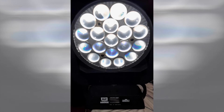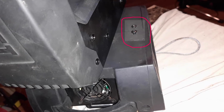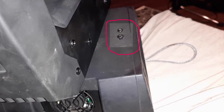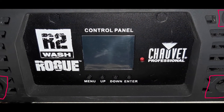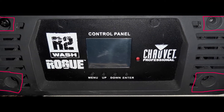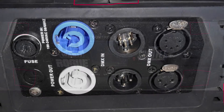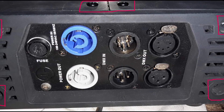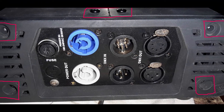You'll have to remove the front and rear panels of the unit and the sides. Remove the two Phillips screws at the top of the unit as indicated here. You'll also have four Phillips screws in the corners of the front panel to remove. You'll have the very same thing on the rear of the unit: two Phillips screws at the top and four more Phillips screws in the corners. Just remove all of those.